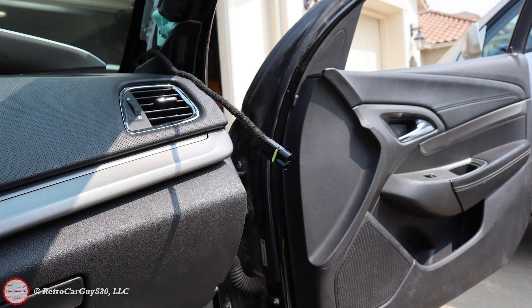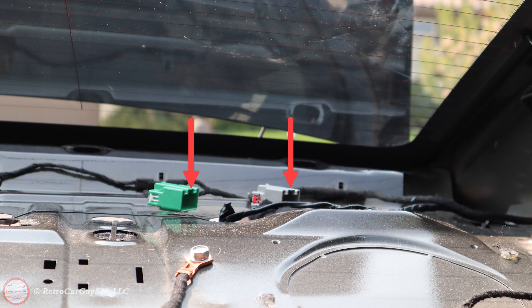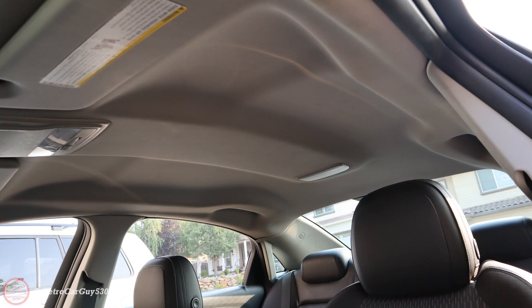I was able to find a fairly good shape headliner at a local wrecking yard. The removal of the headliner itself from the roof is not too hard — it's mainly held up by the materials around it, except for the clips at the rear. There are cables at the A pillars and C pillars that need to be uncoupled from their electrical connectors and retention clips. The ones on the replacement weren't all that great, so I wanted to carefully remove the old headliner to reuse those.